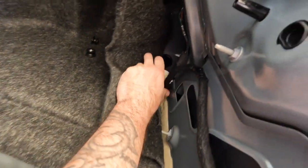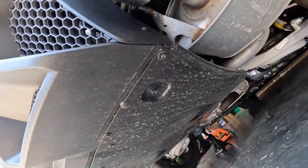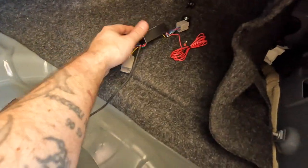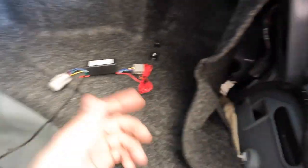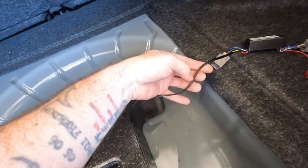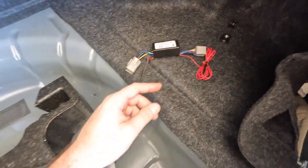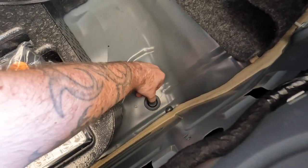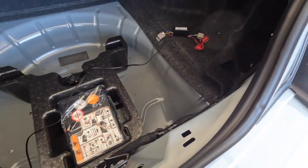We need to fold down this section and get to the clips on each side, then remove the rear tray with a few bolts to gain access to the light. The pigtail is male and female so you can't mess it up — they pigtail in between. There's a center wire connecting the two sides and an exposed red wire that feeds down into the bottom of the car through a body fill plug.